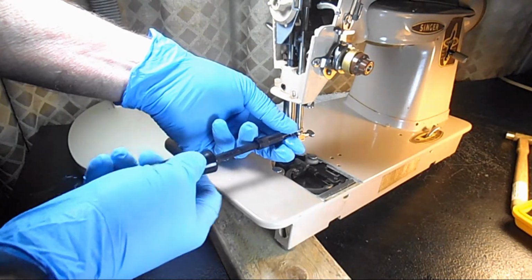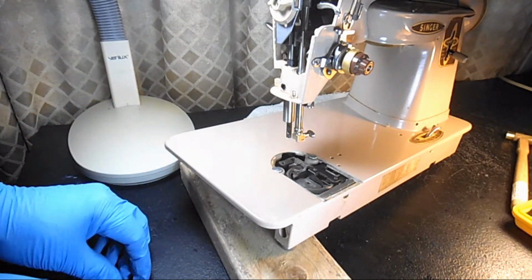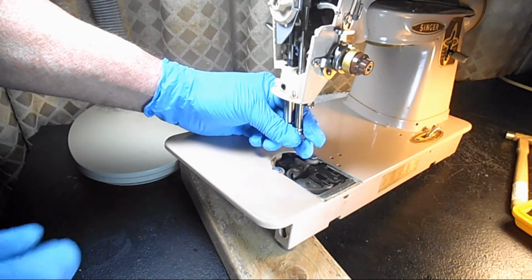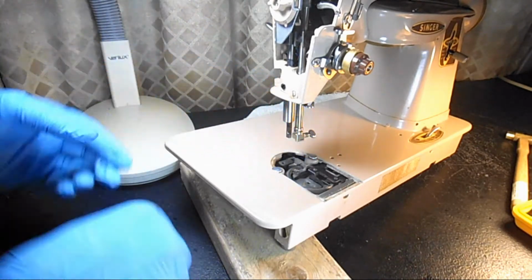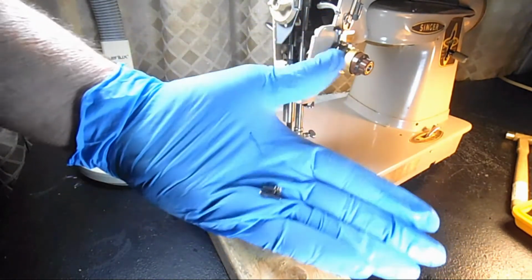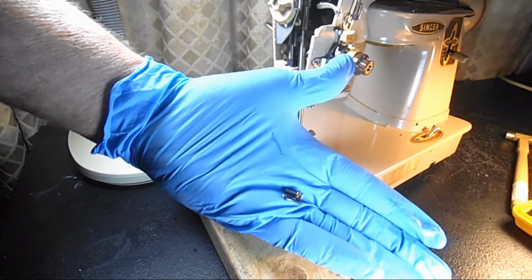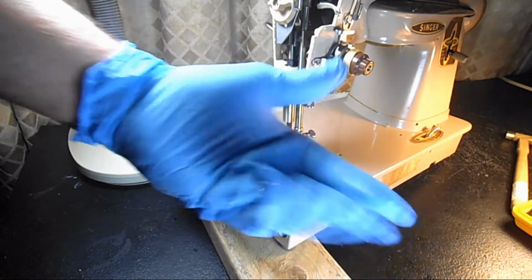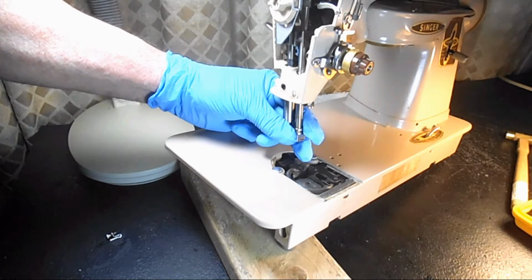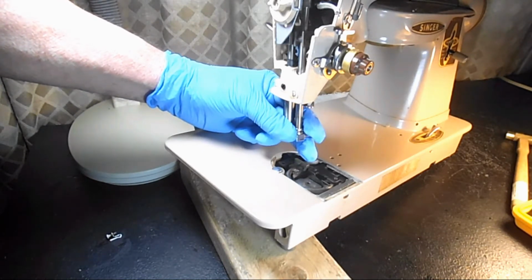Or if you had to replace a rusted or bent needle bar, or you wanted to test it to see if it was bent. So once we, I should show you that. You can see that little screw and thread guide, they come apart. Once you've got the screw out, it should just pull straight down. I usually twist it a little, and sometimes